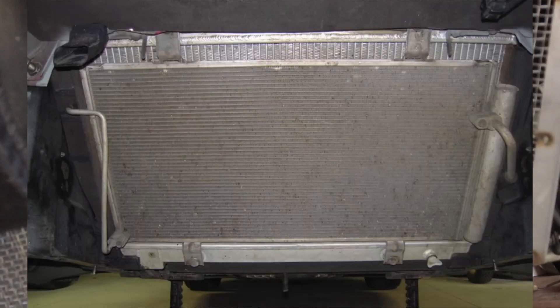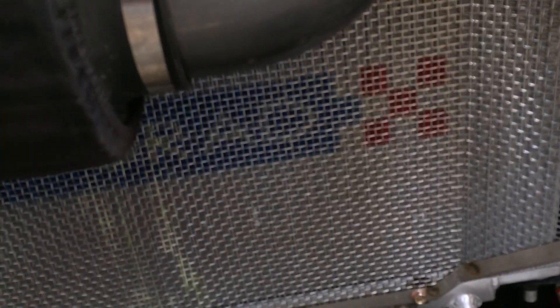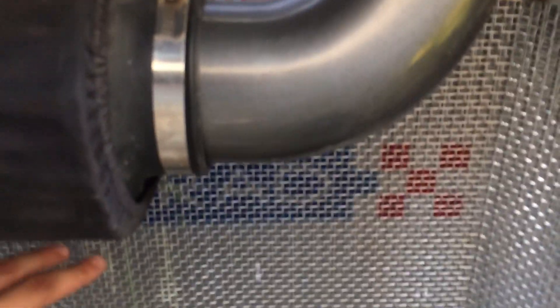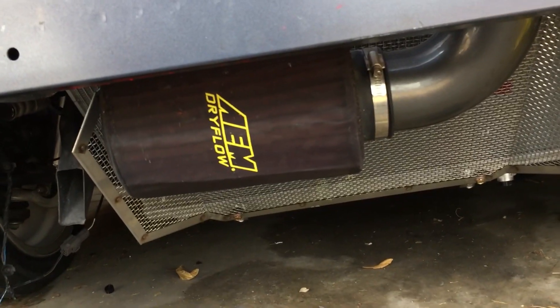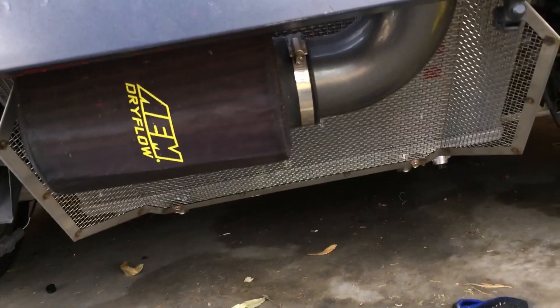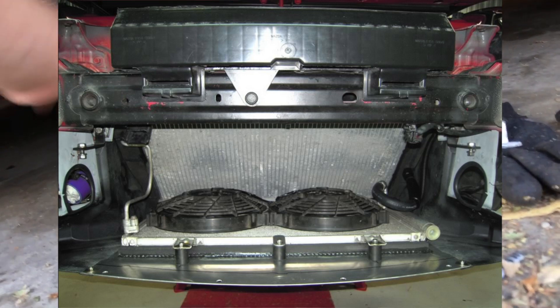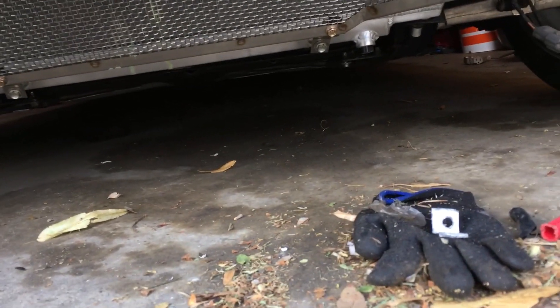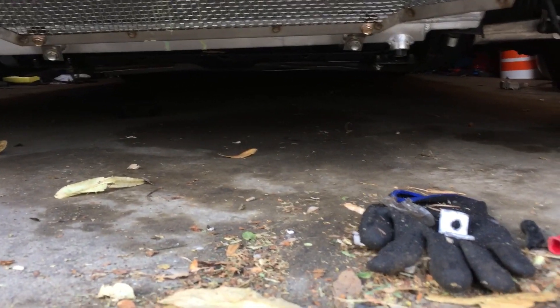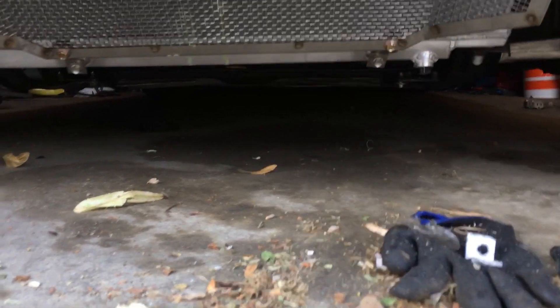But I'm not going to revert from my original plan, which was to remove the condenser to unblock airflow going to the radiator. The condenser mounts right in front of the radiator. What I'm going to do is get LRB Speed aluminum under tray and uprights — they're about $180 shipped — and with the condenser, flat mount it on the under tray, cut some holes in the bottom to vent it, then put some fans on the back of the condenser so I can get airflow coming through it on demand. When I turn the AC on to cold, the fans will kick on and I'll have fully functional AC.